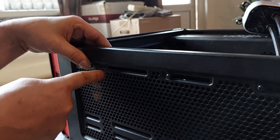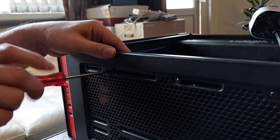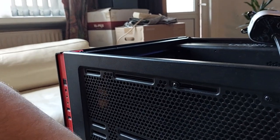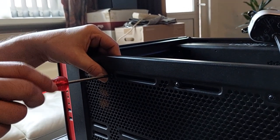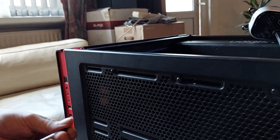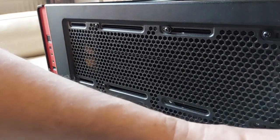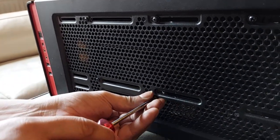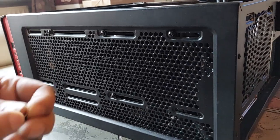Because this is a very small tower, I need to use one of the holes here — it's not the original hole for the cooler, but it doesn't matter, it works perfectly. Don't tighten the screws at first. Put all the screws in loosely so you can adjust the exact position, then move it to the right place and fasten all the screws.